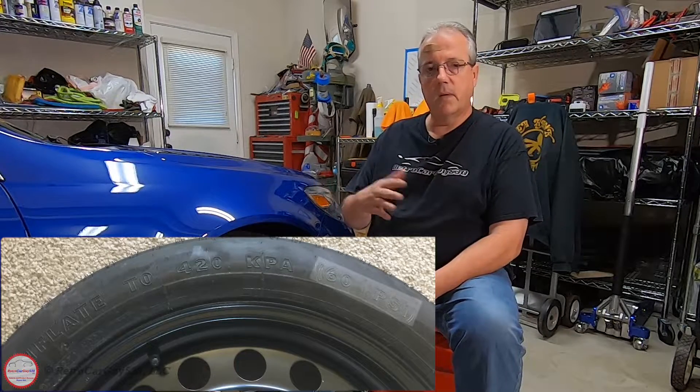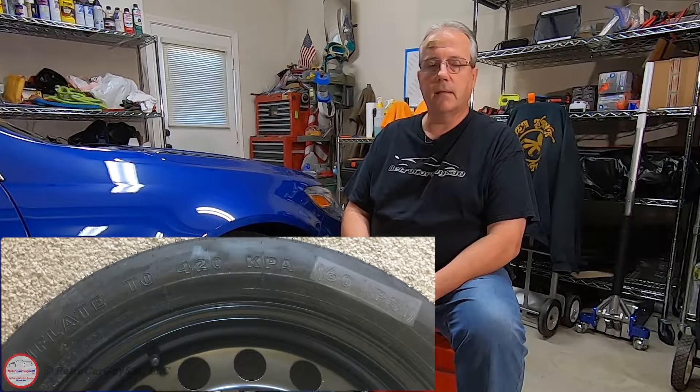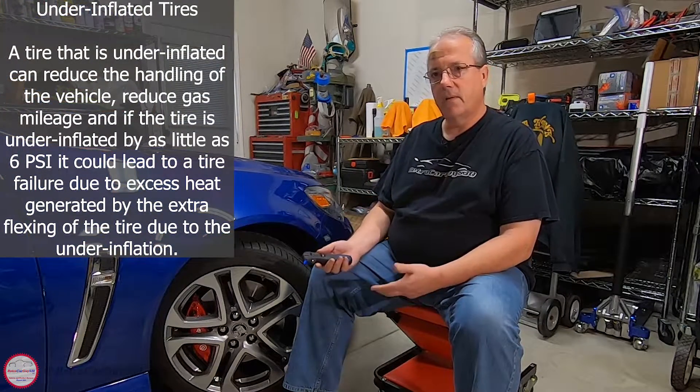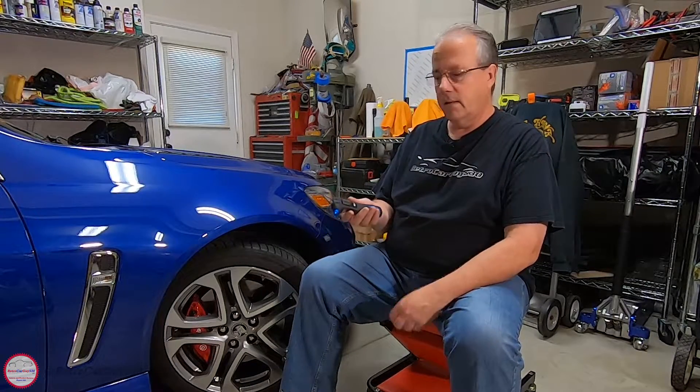If you have a regular style tire and rim, check what the proper inflation is for the vehicle. You're looking at the decal that's on the driver's side door area, on the B-pillar area or on the door itself. Check for that and look for the proper cold inflation value. Once a month, go around and check the tires. Make sure the tires are cold — after parking overnight or not sitting in the sun — because the value stated there is cold inflation.